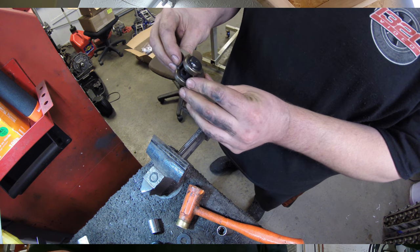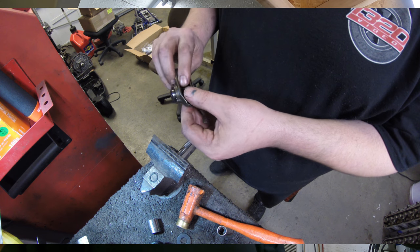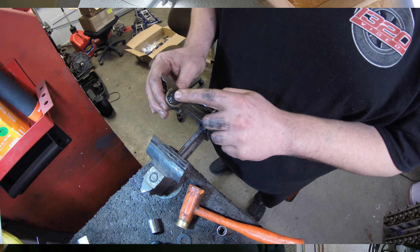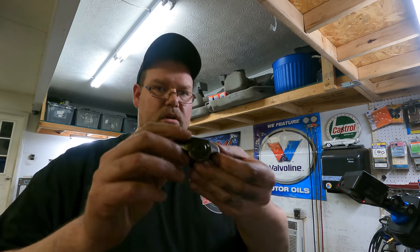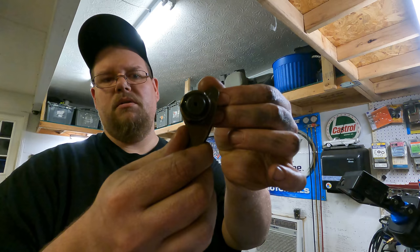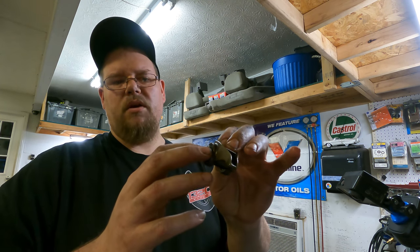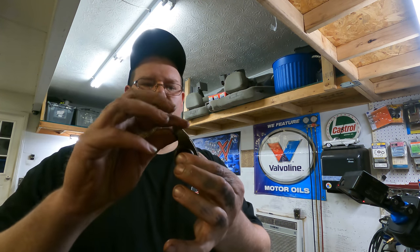And this upgrade is very important if you're running any kind of aftermarket springs or high lift cam or anything. The trunnions themselves are way thicker than the stock ones, and the snap ring traps the needle bearing, so if for some reason they do come apart, they can't really get out because of the snap ring. So it's just a much better upgrade. You've also got more travel.